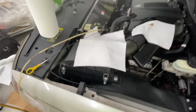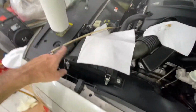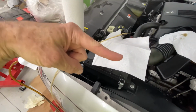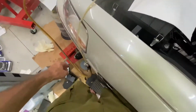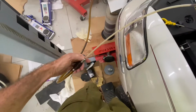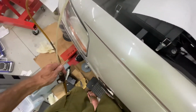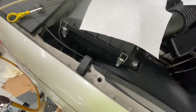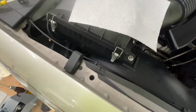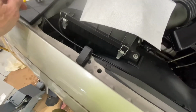you will actually discover that you can't suck any oil out. The dipstick must go in, and if the suction line is pushed too far, it must then curve up. That's the only way I can guess. So what I discovered is that if I pushed in this suction line all the way up to the hilt here, well, I didn't get any oil. But if I measured it against the dipstick and put it in approximately the length of the dipstick, approximately, this isn't science, folks, it sucked all the oil out.